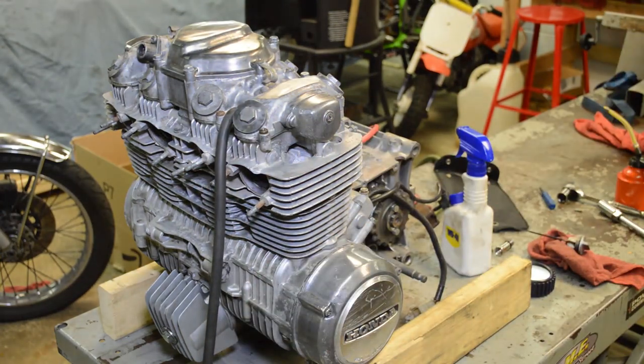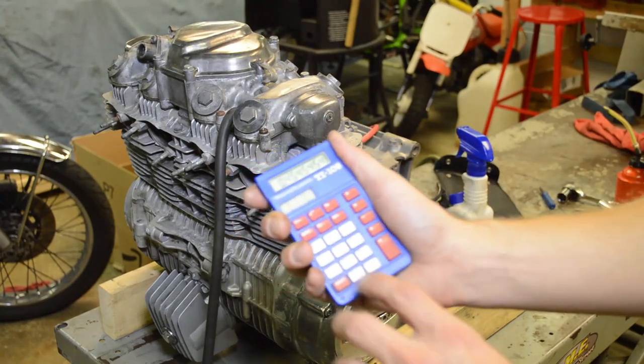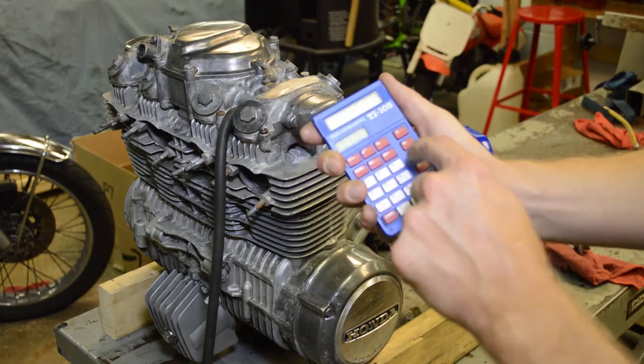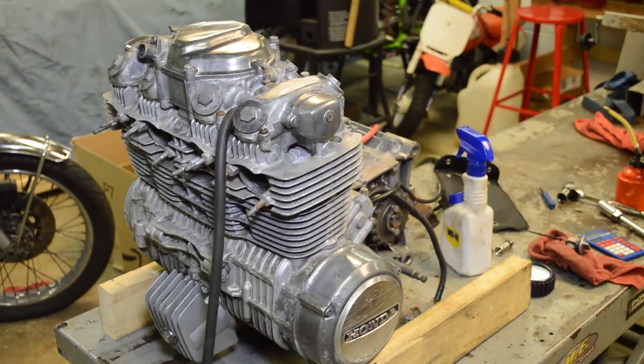Let's do some quick math here and see what leakage it is. So we got 22 minus 12 equals 10, divided by 22. That's 0.45, times 100 to convert to percent, and we got 45.5% leakage. That's horrible. You don't want any more than 20. 5% leakage is an engine in excellent health, 10 is normal, and then as it wears, you want to go up to 20%, and then it's deemed you need a rebuild or you've got to do something.